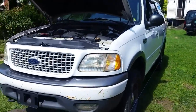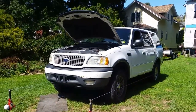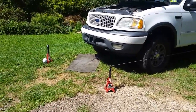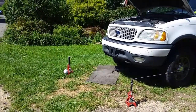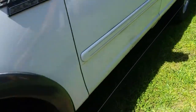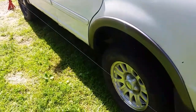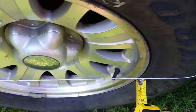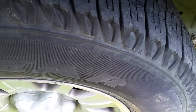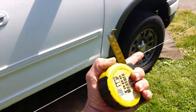All I have to do now is tighten this up. You can see how far it was out - the tie rod end got pushed out to bring the front of the tire outward. If you want to know how to actually do this, I have a video on my YouTube channel, and there are other videos online. Everybody has two jacks and everyone can buy a ball of twine for a dollar at the fabric store. The key is to make sure you get your string pretty close to the tires all the way around.